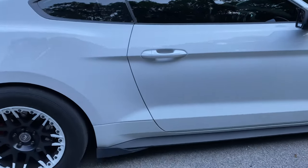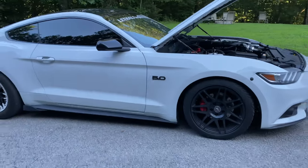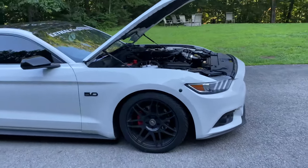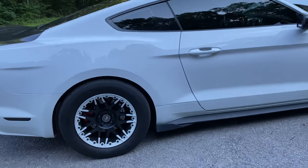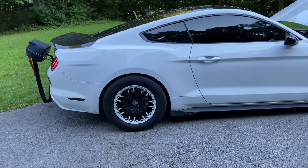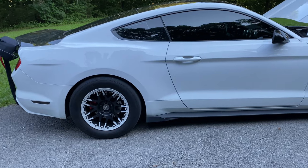And then the next point is going to be braking. A lot of people add a lot of power and don't add a lot of braking power, I should say. So what I have done is went with Baer's SS4 2.0 kit, front and rear. And for those S550 guys who still wonder, this was the kit that you can run a 15-inch rear wheel with, although it's like a 15 by 9.33, and most of the fast cars run on a 17 anyhow, but that's beside the point. If you want that, this is available with this kit.